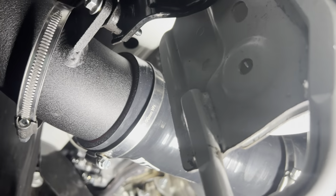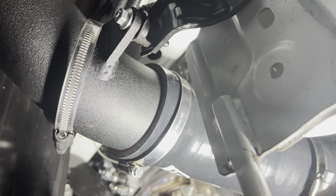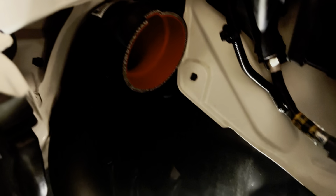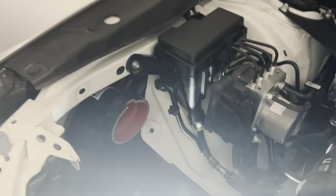Kind of lightly tightened the bracket in. And then we're gonna get the air box in, not tighten it up, but fit check it to get the angle of that pipe right before we tighten down the hose clamp on the 90 degree, because it's going to be fun to get to after that. So we'll get this guy fit check first. Top all test fitted up. This guy's tightened in now on the inlet.